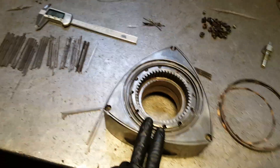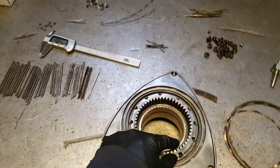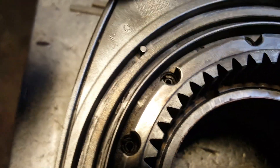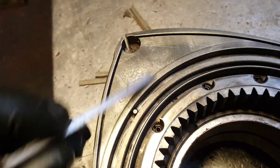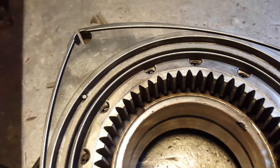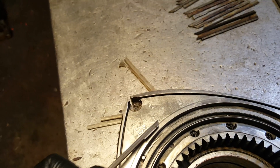Here we have one of the rotors — it's all clean. I already showed you guys how to clean the carbon buildup. It's waiting for the main bearing coming from Mazda. I'll show you all the stamps. If you go to the QR reader or this square letter on here — you see this C right here — that's your weight. And then the size of your side seals is this letter here; this one has a letter Q. I'm gonna upload the sizing chart in the video.